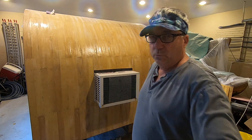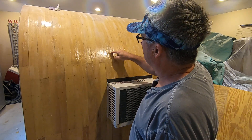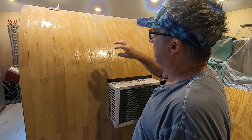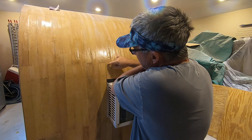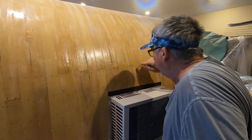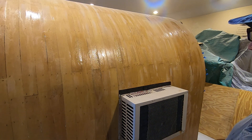Welcome back to the 5x8 Teardrop Woody. I've been doing a lot of stuff that just really is kind of a boring video. You can see here where it looks a little checkered or a little textured — that's where I had to put on some spare strips of fiberglass and epoxy. It takes a lot of it. You have to go over this and look at every little gap to make sure it is sealed so water can't get in there. I've been going over every single gap, and I'll go back again and find another one that needs a little bit more fiberglass on it.